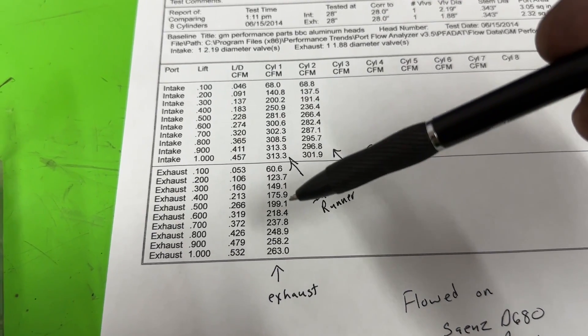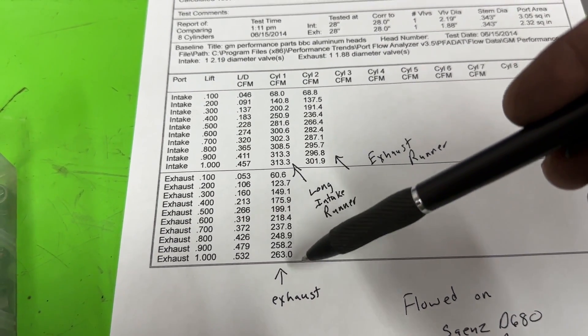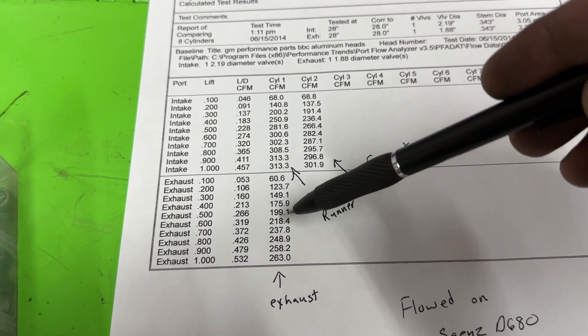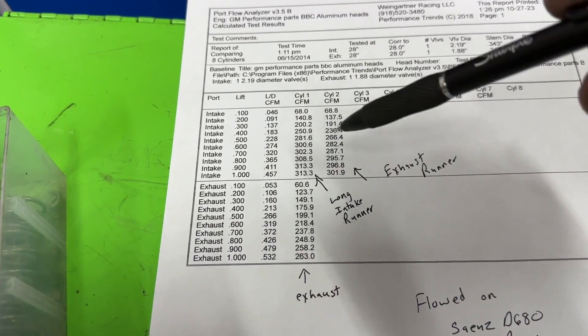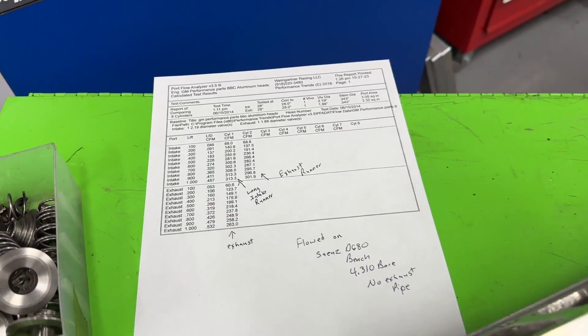On the exhaust — this is what I mean about it not being raised up as much as others. I think if the exhaust port was raised up more, these low-lift numbers especially at 0.400" would come up. But the peak isn't so bad; that's livable, and that's how I can tell it is raised up some. If you raised it more, the low-lift numbers would probably improve.